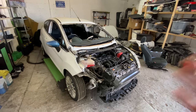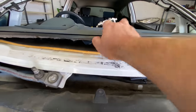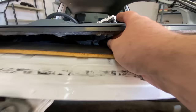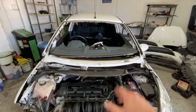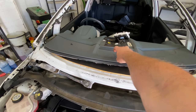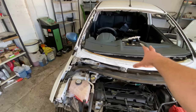We have got to come backwards a little bit with this car because I forgot, and I didn't realize until I saw someone message me about it. They said that you forgot to put the sensor through the dash, which is the AC sensor, this one here. You can just see it there. So that's got to go through the dash, and I forgot all about that. I've got to drill a hole there and two little slots each side, and then it will fit in, and then it will connect up. So, yeah. We've got to crack on with that, get that done.